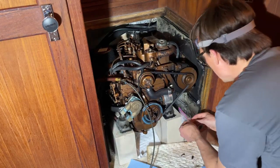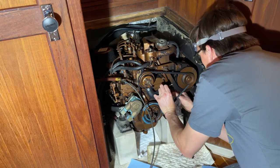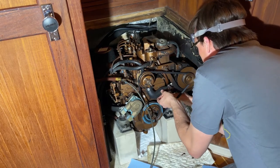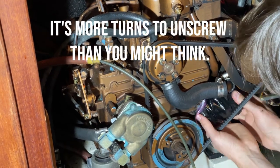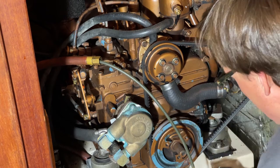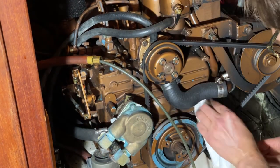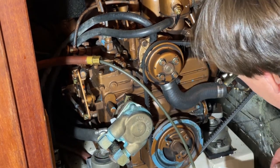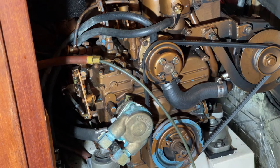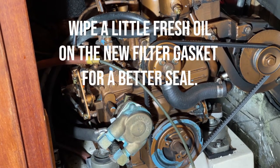Now that the old oil is removed, it's time to change the oil filter. I'm going to put this plastic bag over the oil filter to try to catch as much of the oil that spills out as possible. I think we actually caught most of it, but we also made a big mess — we lubricated quite a bit of the outside of the engine, which is not the side you normally want to worry about. Now that's done, I'm going to get our new filter. Before attaching it, we want to take a little bit of nice fresh oil, lube up the filter, and put it on.